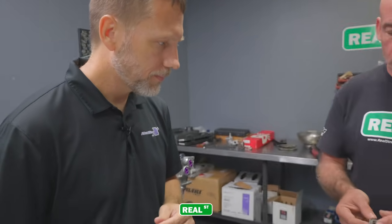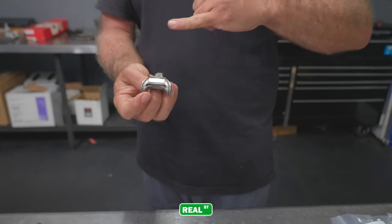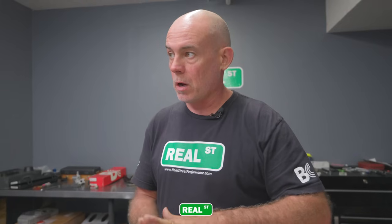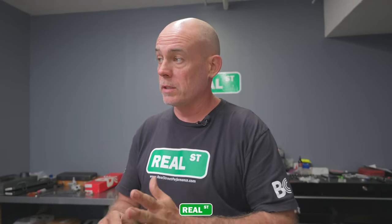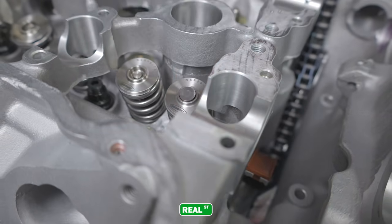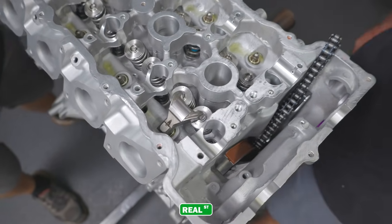Okay, so it's insurance to get the rocker arm to be level in the engine. Correct. The heel of the cam goes onto the take-up ramp and starts to actuate the rocker. It's got the whole footprint, or the design shape of the rocker and the design shape of the cam, interacting correctly. Okay, that's it.